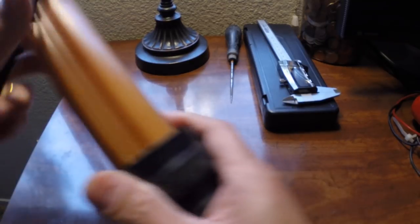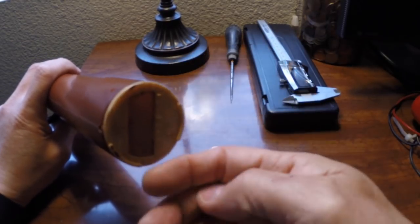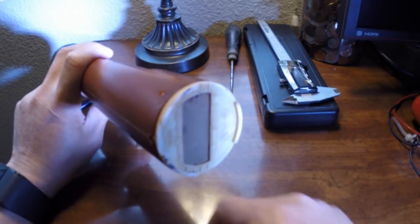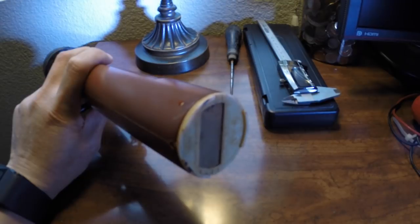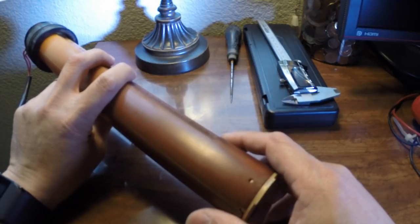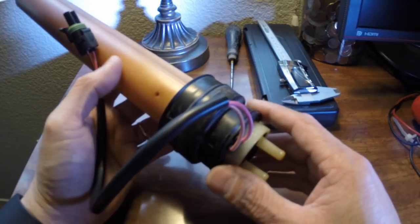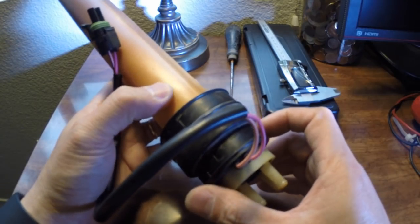In most cases, the magnet is at the bottom right here, just sitting at the bottom of the cap. Sometimes this entire cap is actually off the sending unit and the magnets are at the bottom of your fuel tank — that could be the cause of your non-working fuel gauge. And finally, the third thing: I have a feeling it's my F1 fuse, which is 250 milliamps or a quarter of one amp. I'm going to go through the troubleshooting to help you guys repair your fuel gauge.